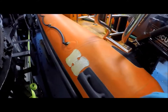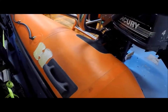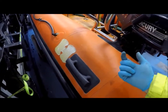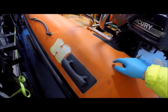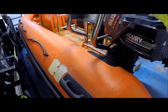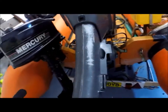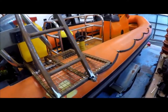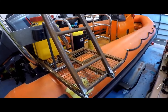When we first brought this, the only issue we had with the tubes was a slow puncture in this tube here. I've fixed that now - it was only a tiny little hole right underneath the bottom of the tube, so I've put a nice round patch on that. We've also changed the valve on the section on the other side and that's holding well now too. We've actually got tubes which don't lose any air - you could probably leave these indefinitely and they'd hold. That's the way you want it; you need reliable tubes as much as you need a reliable engine.